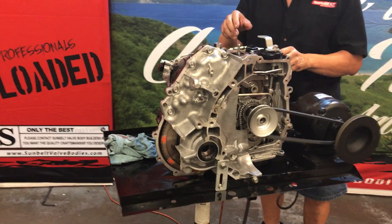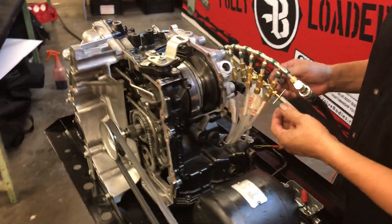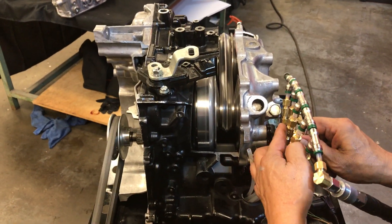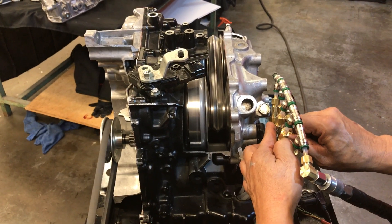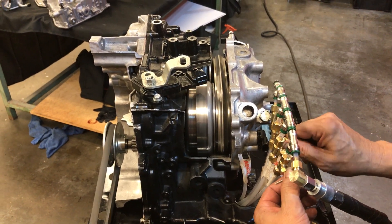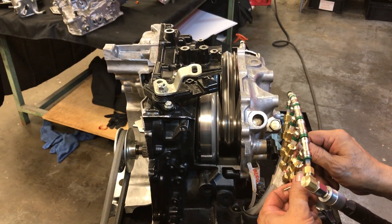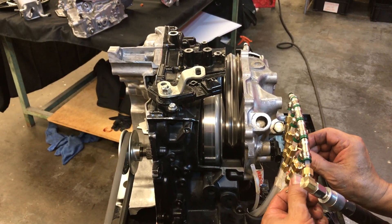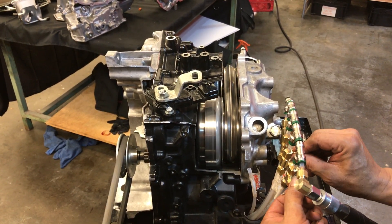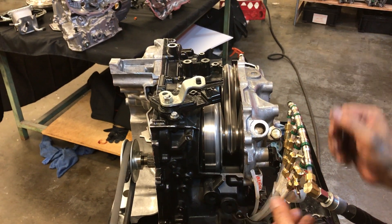Come back in — now I'm going to show you how the pulleys work. Here's your primary pulley. This is your A solenoid kicking up, and the variator starts to bring in. As you can see, you're going to full ratio. As you bring it down, your B solenoid comes in and brings it back down. I just turned off the B and I'm turning the A solenoid back on — you can see the pulley is getting tighter. I'll back off and bring it back with the B. That's the function of the valve body: A and B solenoids.